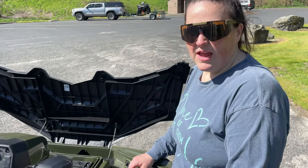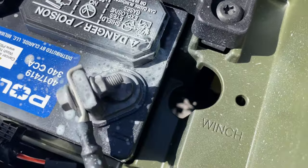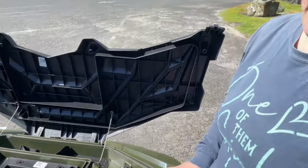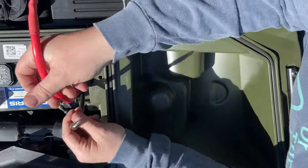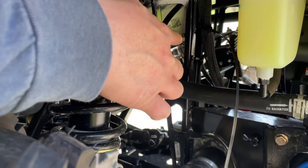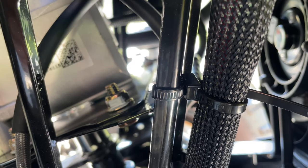Polaris has already made a cutout for this right here. We're going to route the positive and negative cables for the winch up through this hole here so that we can get them plugged into the battery. There's a double zip tie here that we will attach to the frame to make sure this looks clean and nice. Make sure you run the zip tie this way so it keeps it off of the frame.